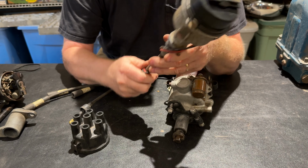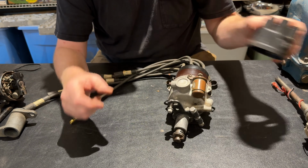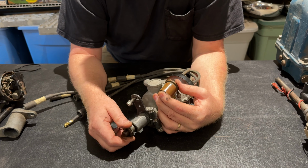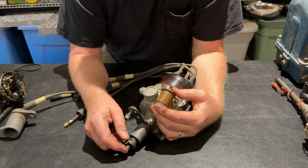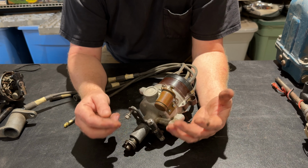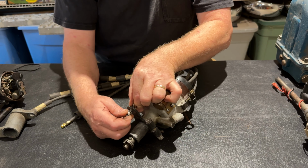And so the point I want to make also is that there's a lot of industrial applications for the Continental Red Seal 226, which is the same motor that all these cars have. Same basic motor: Kaiser, Frazer, Willys, Jeep, etc. So there's a lot of parts available from Hyster and other fork truck companies and generator companies and companies that do air compressors, portable equipment.